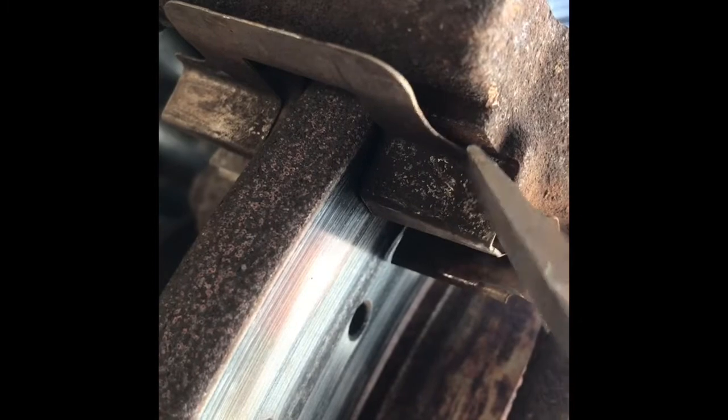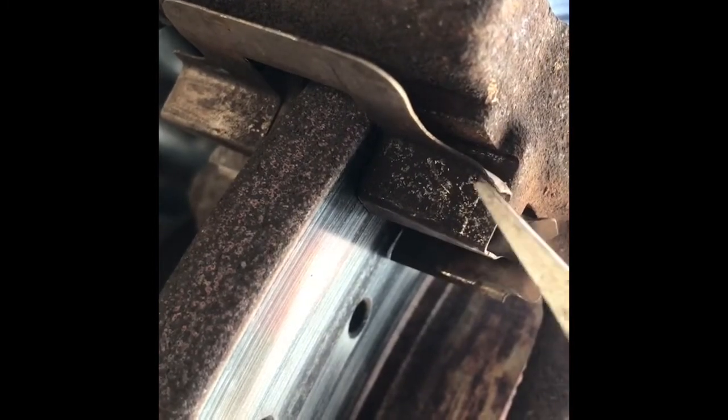And what happened is the brake pad slid this whole guide over, and the guide is meeting right here on the disc. So this whole guide, maybe I didn't install it or rushed it, or I can see something got bent right here on the corner, but this is what's causing the screechy, scratchy noise on my brakes.